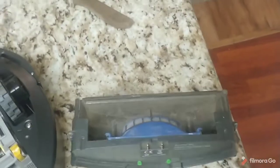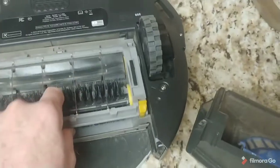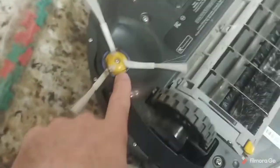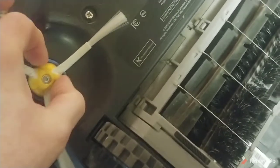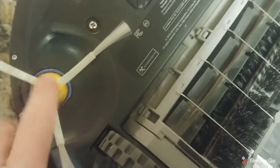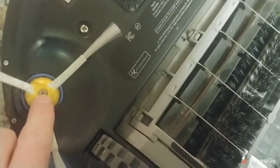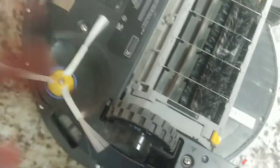And when you order the kit with the brushes, it has the rubber brush and then the spin brushes. Your problem comes in that there's two types of brush. One with the octagon, which is the common one, the one you're going to find in the cheap kits. And then there's the round one, which it probably came with. The problem is the hole in the center is a little bit bigger on the round ones than on the octagon ones. So all you need to do is take a drill bit and drill that little hole out just a little bit larger, and those work fine.